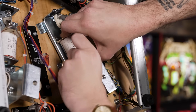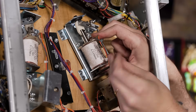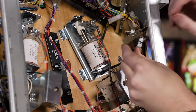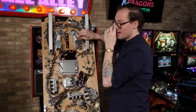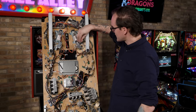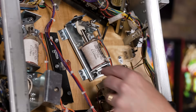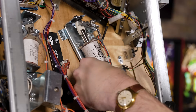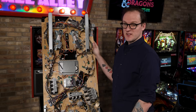Get the cap screws. Now that we have started the screw, drive it in with the Allen key — we're not going to tighten it all the way. Start the other screw first before torquing. With both coil stop screws snug, torque them in place. Position the Allen wrench to allow tightening and give it a good swing. Now we have everything pinned in place.